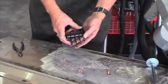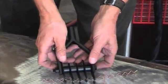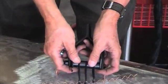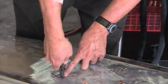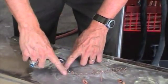On older cars, we may need to replace trim rivets. And we have a setting on there for trim rivets. We'd like to put those on tight enough that they aren't going to come off the car. So we have a little magnetized electrode. We're in memory slot number 1. A separate time setting and power. And we're going to let this burn on. And we'd like this to turn a little bit gray at the bottom because we don't want it to come off the car.